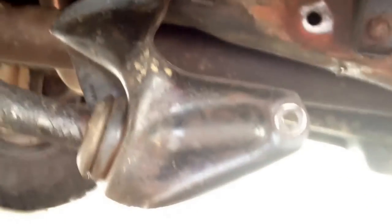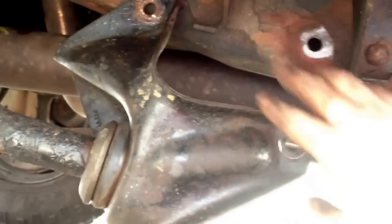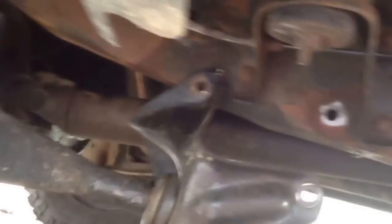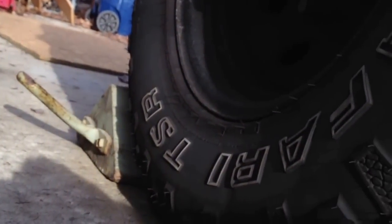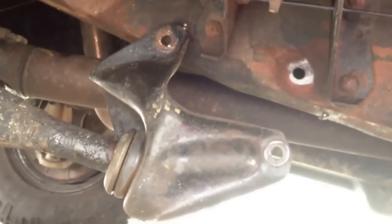We've got all the bolts undone and the bracket is hanging on by just the radius arm. Up in there is the front axle radius arm. What you're going to find is that when you disconnect this, the last bolt will be kind of hung up because the wheel is actually going to start to move forward as the radius arm swings down. So you want to chock the front wheel somehow to keep it close to where it was, so you won't have as hard a time putting on the new bracket.